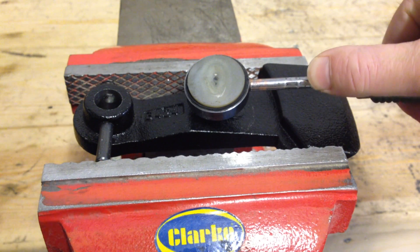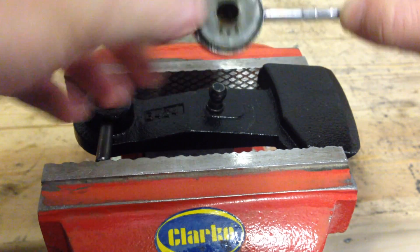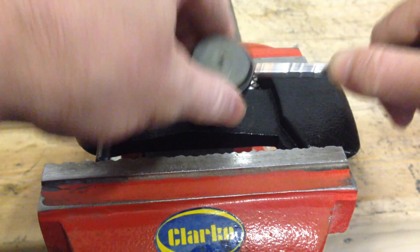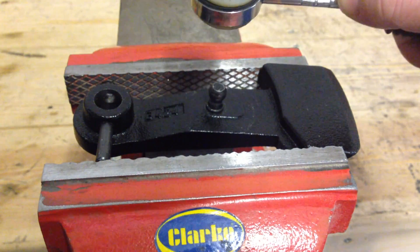On these models it's a very common problem with the linkage on the gearbox. This plastic wears down inside — it's a very soft material operating on metal. This deteriorates and causes the linkage to pop off, which prevents selection of gears.